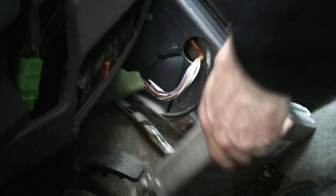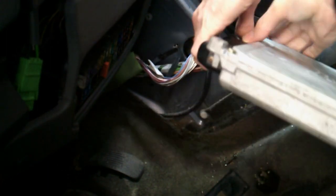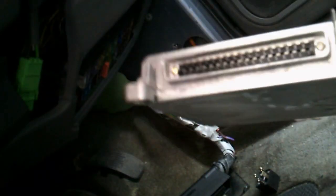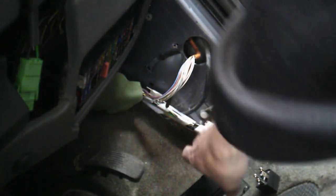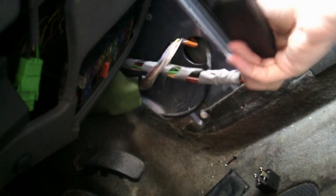So on this metal box it's got a large multi-way connector — lift the plastic clip. A little bit of jiggling on the connector, I don't want to be too brutal with this. There we go. You can see the large multi-way connector and the connection into the ECU. Now we've got our ECU. First of all, let's look at the pins — I can't see any corrosion or potential damage on the pins. What we're looking for is slight greening on the pins, which normally means water damage. The connector itself also looks okay, as does the loom.